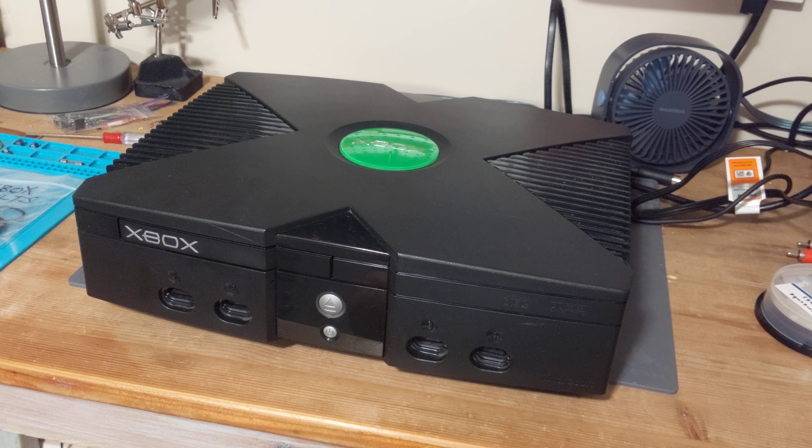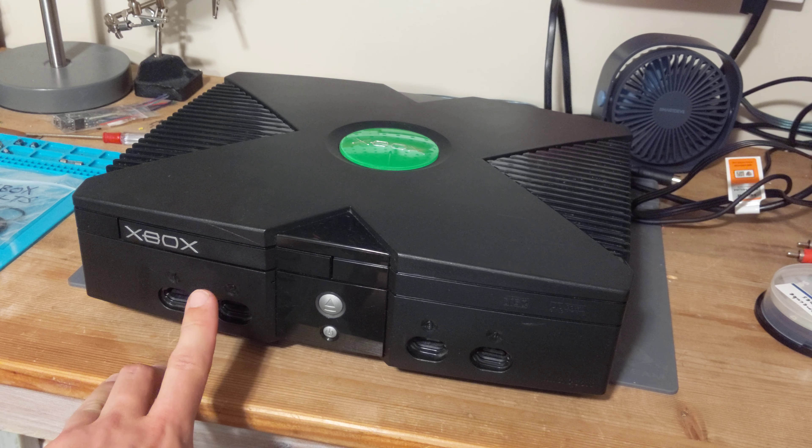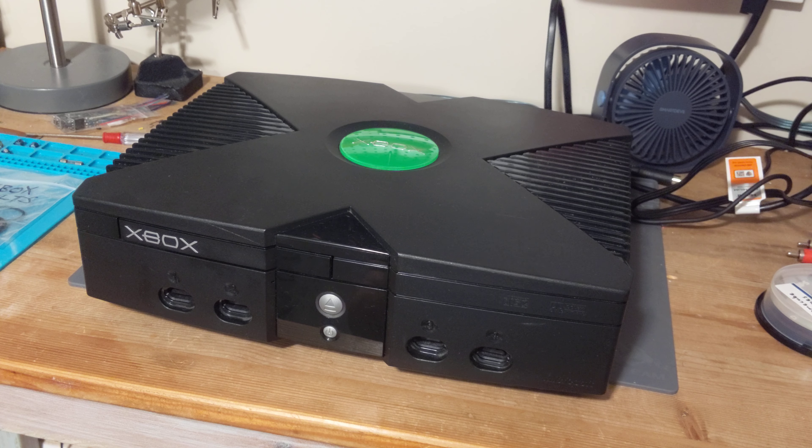What is happening everybody, this is Patrick from HDRGB Entertainment. Today I'm here to show a quick fix and solution to a common problem on the original Xbox system — the front tray gets stuck. There are a few variations: it's completely stuck and won't open at all, or it opens and closes frequently and periodically won't boot games. The reason is a little rubber O-ring belt inside that gets worn out over time and has to be replaced.